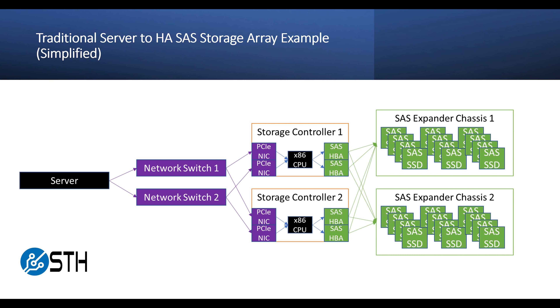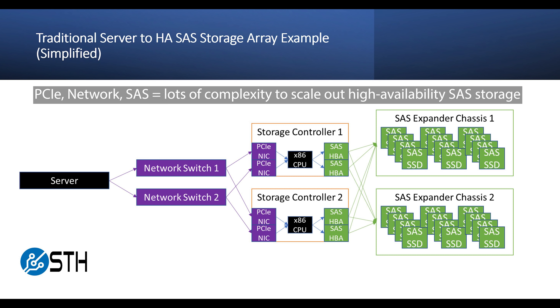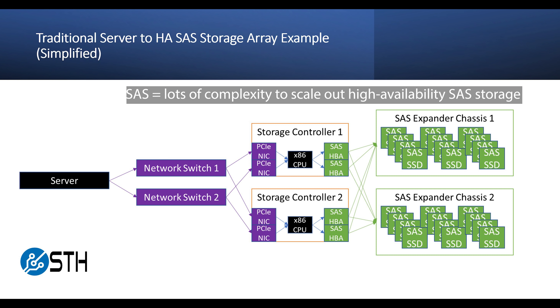So then we have some network cards — even if they're Fibre Channel adapters, or traditional Ethernet adapters, InfiniBand, whatever you have — you need to have those kinds of network adapters on the back of the system, and that basically goes out to your network. And in some ways, that's kind of stupid, right? Think about how many conversions you have: you have drives, you put them into a chassis, which goes into a backplane, that backplane then goes to an x86 server, and then from there it has to go over the network. We have to do another translation to PCIe back over the network, out onto Ethernet, and then it has to go into the system. That's a lot of different translations.